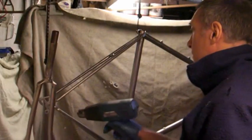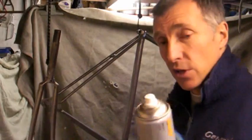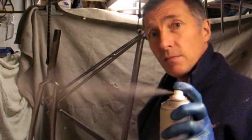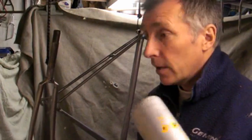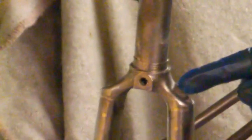So I can get out of this bloody garage because it's freezing! OK, so that's the frame and forks warmed up — not hot, but it's taken the chill off them. The paint's nice and warm and flowing freer inside. What it also means is that when we spray the paint out of the nozzle, we get a finer spray with fewer blobs in it, so there's less finishing work to be done. So we're going to start with the forks — we need to spray the intricate areas first, the bits that are difficult to get to.